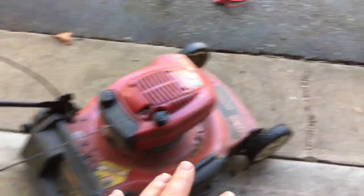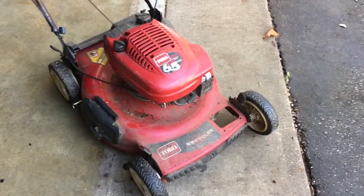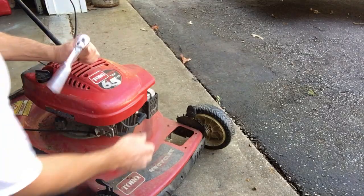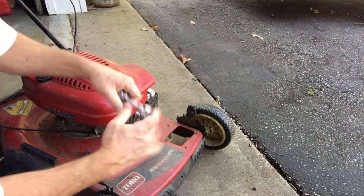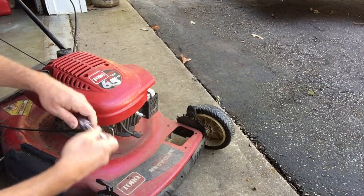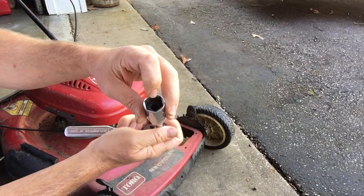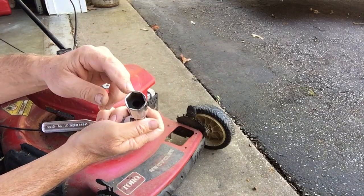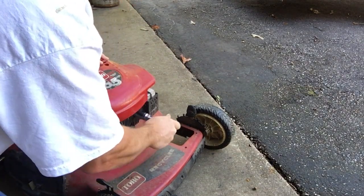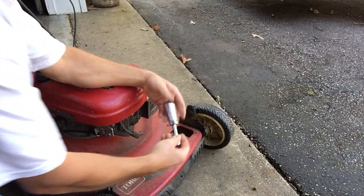So that way I should have electrical. I'm going to set up on the tripod and I'll remove the spark plug and show you how I'm going to do this. The first thing for removing the spark plug is to remove the wire — it should just pull right off. Then you get a wrench; this is 13/16ths for this particular plug, which is fairly universal. This one is specially made for plugs — there's a little black rubber washer in there that helps hold the plug in.